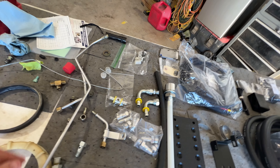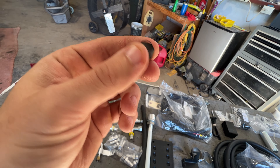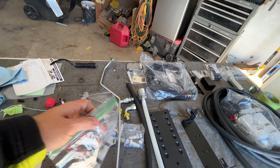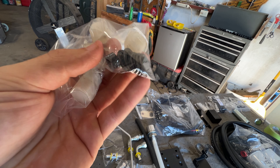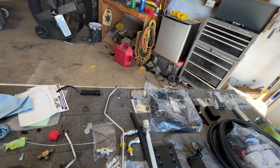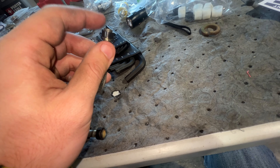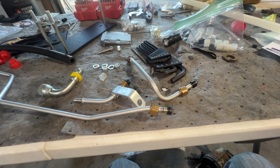With that being said, I did have to go ahead and order new rubber grommets. The old ones were getting all boogered up, and if you don't have a good seal on these you're going to lose your prime for your engine and your fuel system, resulting in hard starts. So instead of going to Geno's Garage and paying $17 for a grommet, I went to Oregon Fuel Supply and got all new crush washers and all new grommets. Now we can make sure we don't lose any prime and get a good seal on all the fuel lines.